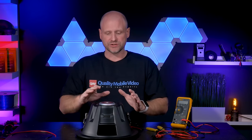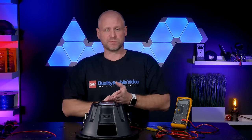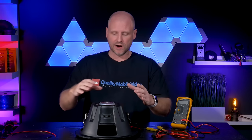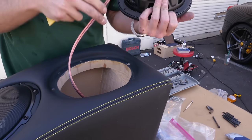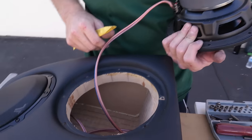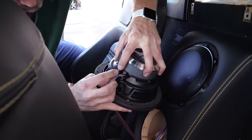One of the more common questions we get before showing any wiring is: do I need a specific type of speaker wire or special wire for the jumper? No, it's not. It's regular speaker wire. Whatever you're using to wire your subwoofer to your amplifier, you'll use that same wire to make the jumpers.